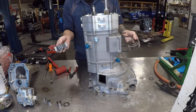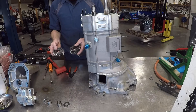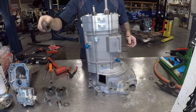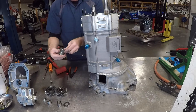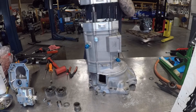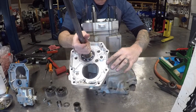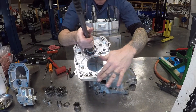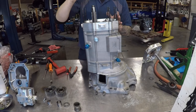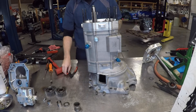This transmission was geared for Elkhart Lake last month, and in this particular car that's about 130 to 131 miles an hour. So now we will just start unstacking the cases. Once again you can see the beautiful work that EMCO did — everything is O-ringed. Very, very nice. In our rear bearing case we have another lock and another nut, same situation as before.